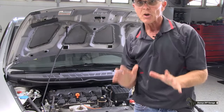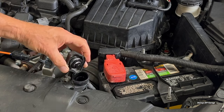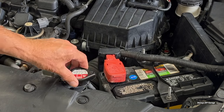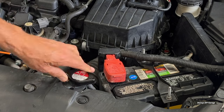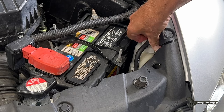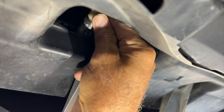Next up, we're going to check our coolant. You want to check your coolant when the engine is cold. Remove the radiator cap, put your finger in to see the level. If the level is good, go ahead and put the radiator cap back on. If the level is bad, go ahead and add a little coolant. Also check your radiator overflow bottle to make sure it has some coolant in there — if it doesn't, go ahead and fill that up. If your coolant looks like it's in bad condition, I do have a video on how to change your coolant, and I'll link that in the description.